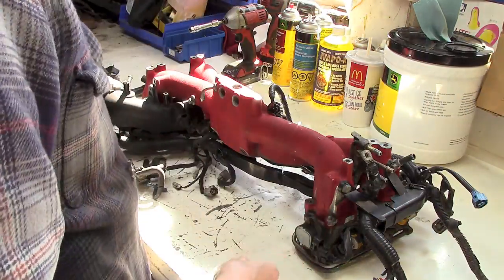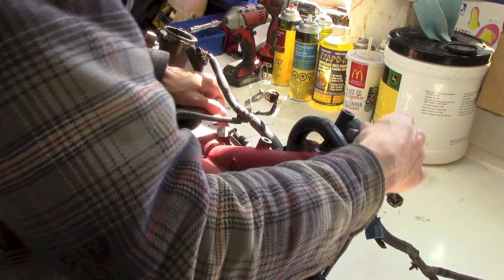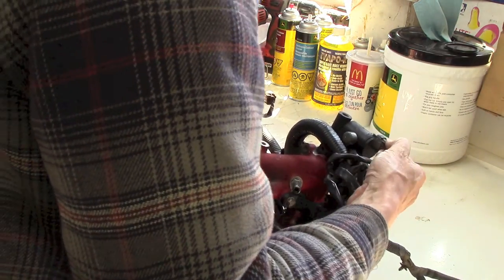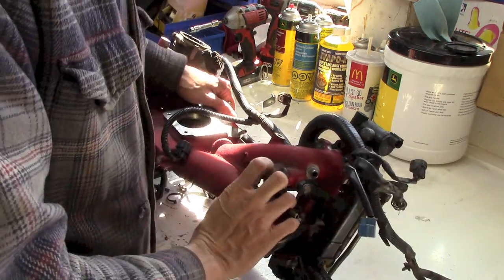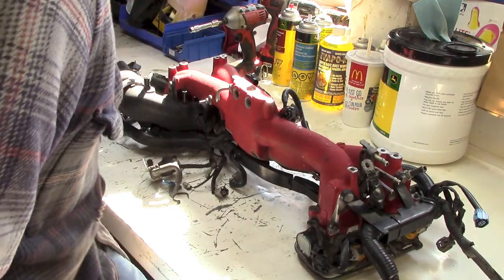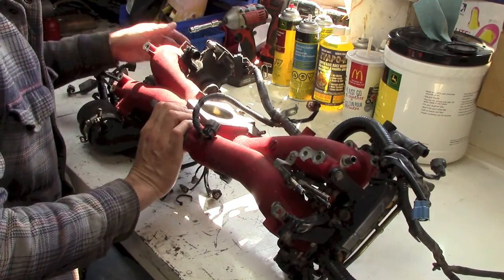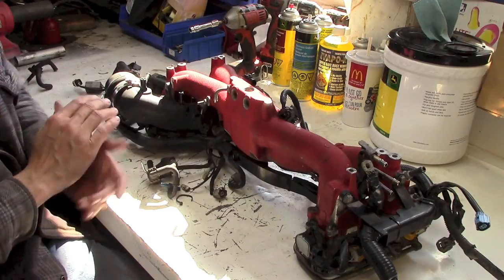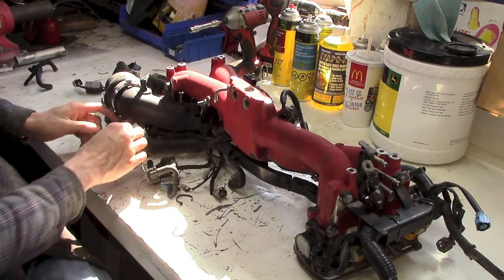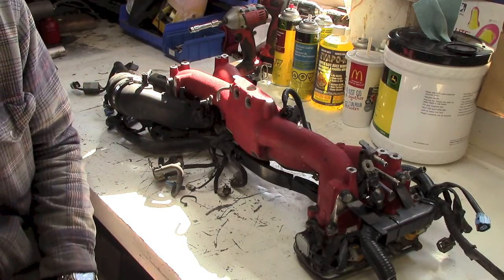Like that. There's a motor, that's the sensor, and the back side is a motor. Now I don't know if this is the side that was giving me trouble. I don't know if the motor is bad or what, regardless, it can all go. The only thing it'll cause is some cool temperature startup idle issues, but after 20 seconds or so, that'll go away.